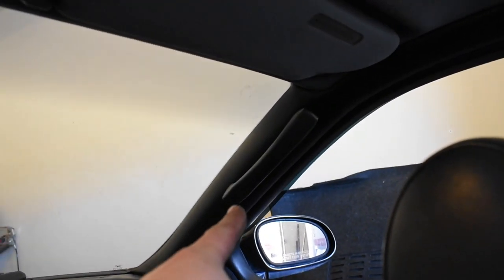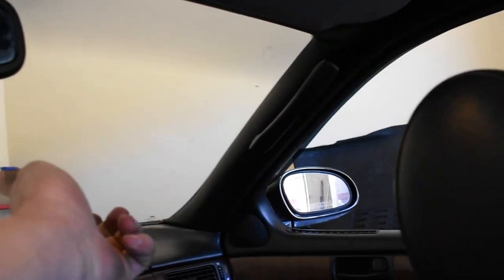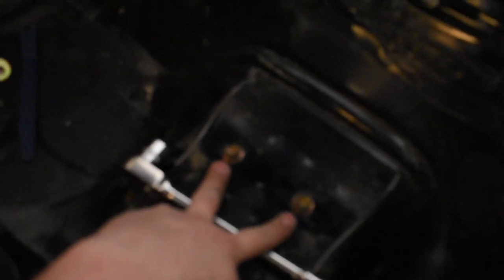It's pretty simple: the sun visors have two little screws under the cover, then one screw that holds a little clip that drops out. The little center visor is just held in by two little screws and then it just pops out. The handle — I had to Google that one, found some help on the forums — you have to pop a little metal clip under the cover and it slides off, then you can drop that whole panel off. I'm also removing the seat belts — the center seat clips are bolted in, and then there are bolts here and a bolt up at the top. Pulling the seat belts since nobody can sit back here anyway.